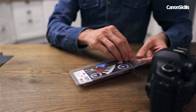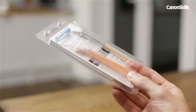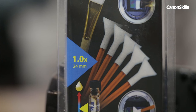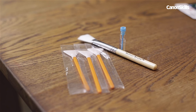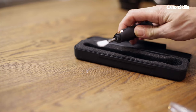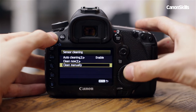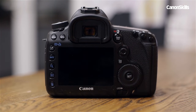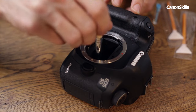That's the loose dirt removed, and now we get to the tricky part: cleaning the sensor to remove those sensor spots. Fortunately, there are sensor cleaning kits available for this exact purpose, and you need to buy the right size for your sensor. The kit includes a sensor brush, some swab sticks, and sensor cleaning fluid. Sensor brushes have a market of their own, with Visible Dust leading the way with their Arctic Butterfly — essentially, the bristles get statically charged and lift the dust off the sensor. Go back into the sensor cleaning menu, select Clean Manually to lock the mirror up out of the way, and with the camera facing up, use the sensor brush first just in case the air blower didn't get rid of everything.